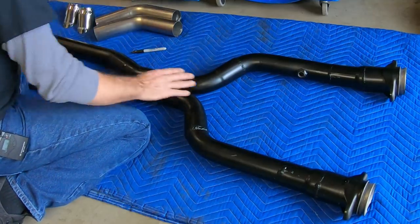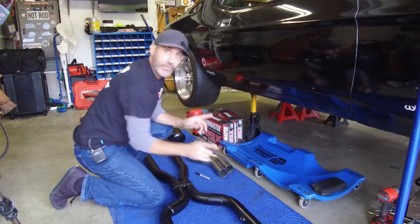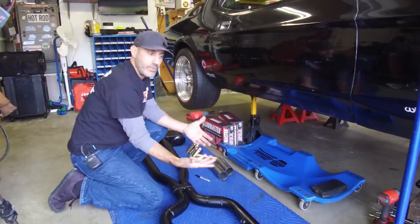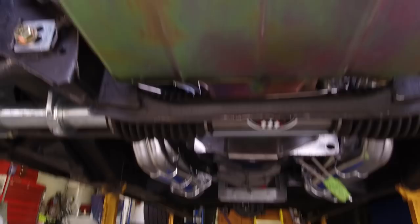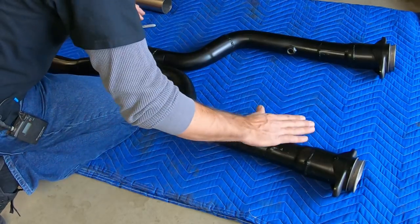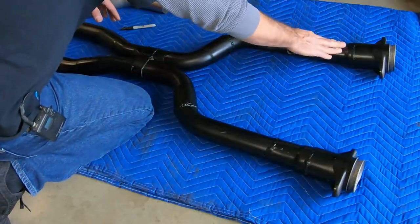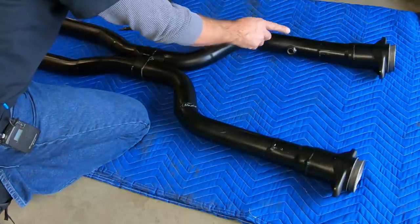The kit comes all disassembled — you have your two tubes out from the header collectors. I do have those Flowmaster headers in this thing; they're full length and they fit perfect. One of my pet peeves is when you have a car with full-length headers and you see the collectors hanging way down underneath. The tricky part was getting them past the center where the transmission crossmember mounts. They are three inch collector going to a two and a half inch pipe, so I had to get a reducer, and I went ahead and welded the bung in for our O2 sensor.